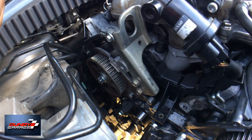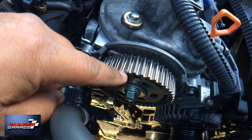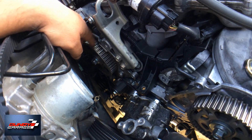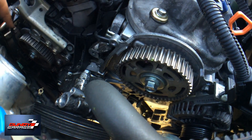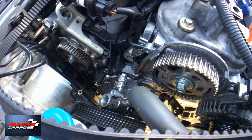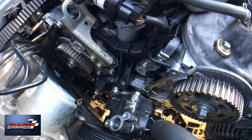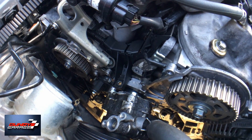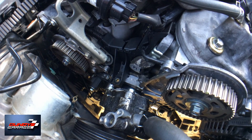One more thing — the front and rear cams are different. The back one has a little lip right here; the front one does not, it's just open. These are 17-millimeter bolts, and if you do the camshaft seals and pull these off, you can accidentally swap these gears — they will fit onto one another. Make sure you put the right gear back onto the correct cam because the timing marks are different and the timing will be off.